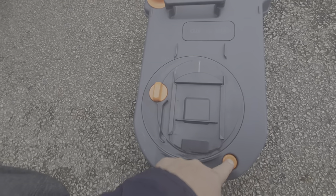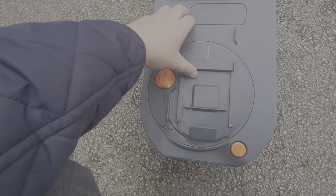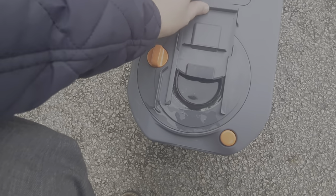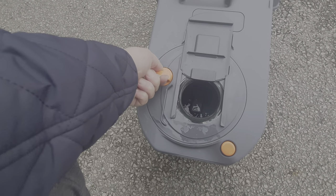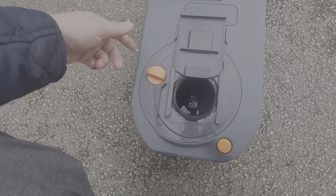Next along is the toilet. Everything that goes down the toilet ends up in this waste cassette. To empty it, lift up this tab and slide out the cassette. When full, slide that nozzle across, unscrew the cap on the end, and pour away the liquid — pressing this button lets air in as the liquid goes out. This container requires chemical to break down the solids and smells. To fill it, slide this across, open up the valve, pour the required amount of chemical in with a little water, give it a swirl to mix, and it's good to go.